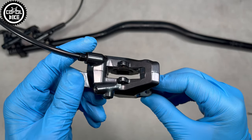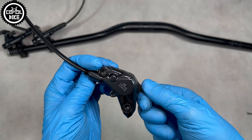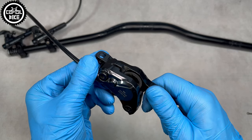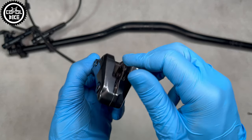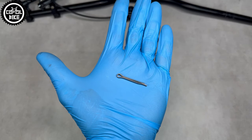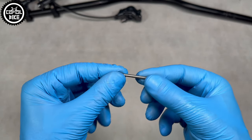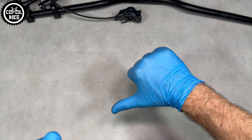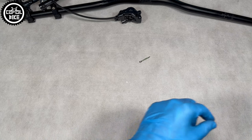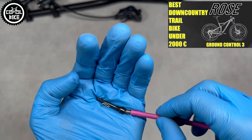But ceramic is not perfect either and sometimes can crack. Although I've never had such a problem, and I've had all generations of XT and SLX from the last 15 years. The downside of Deore that irritates me the most, and I think should not have a place in this price range, is that they have a cotter pin like the cheapest Alivio for 40 euros. In SLX it is done in a civilized way and pads are held by a bolt with a clip.